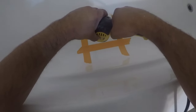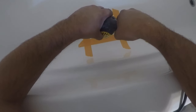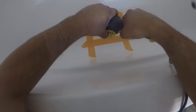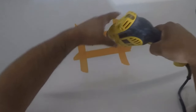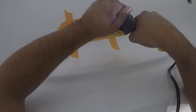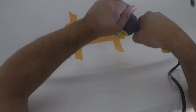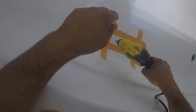I'm going to go ahead and start drilling the hole. Usually I'll just drill a big enough hole that's going to fit the tip of the foam and the little nozzle at the end. I'm just drilling the hole just through the fiberglass. Right below it there's a substrate and I don't want to penetrate that, so I'm just going to fill in the gap in between the substrate and the fiberglass unit.